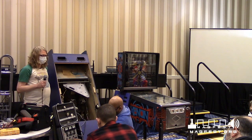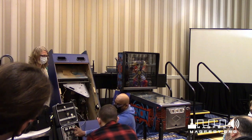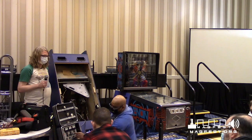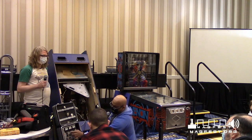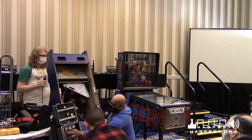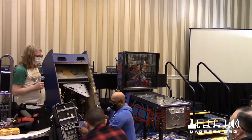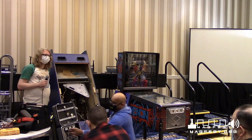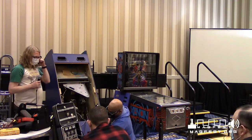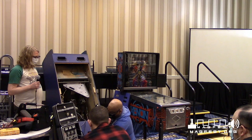So I'll switch it over to test now. Okay, so now you see how this one right here didn't go up at all, that one didn't go up at all. So that needs to be rejuvenated, green does. And this one, the red and black and white, barely went up. It's still in the bad section. What you want it to be is in the green section. So this one you would not rejuvenate because it's already good. These two you would.